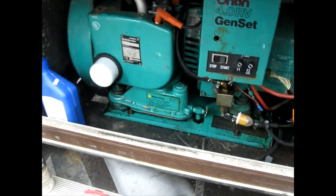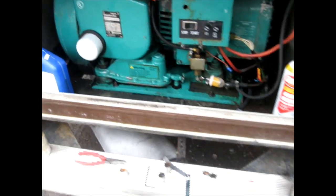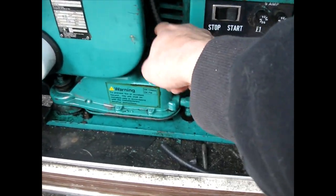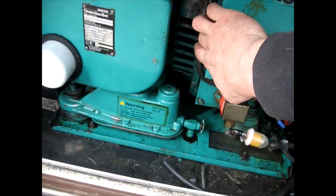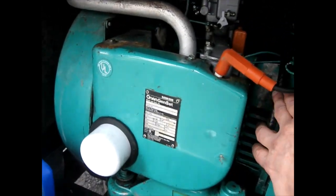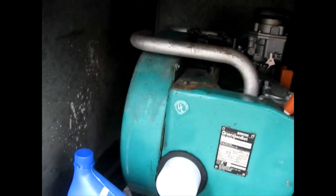It'll run like that for a while. It's definitely got some smoke — not white smoke but it's got to warm up a little bit. I checked the oil to make sure there was no more gas mixing in — it doesn't seem to be, which is good. I've got to tie back this fuel line so it stays away from the engine a bit more so I don't get vapor lock. I'll get a clip for that. I had to go with flexible line versus the hard line because of that nipple I couldn't get off.